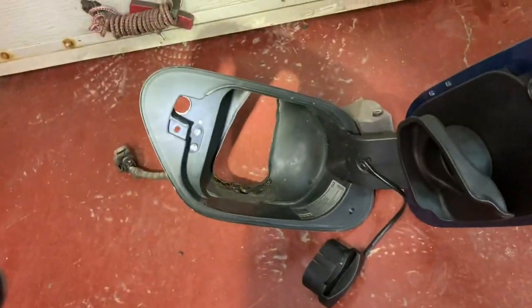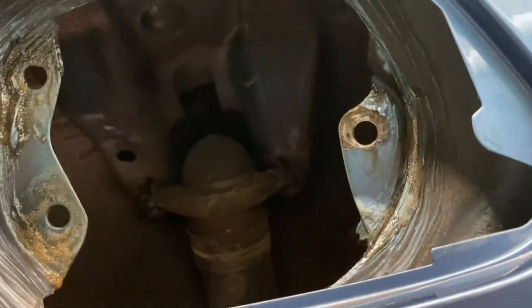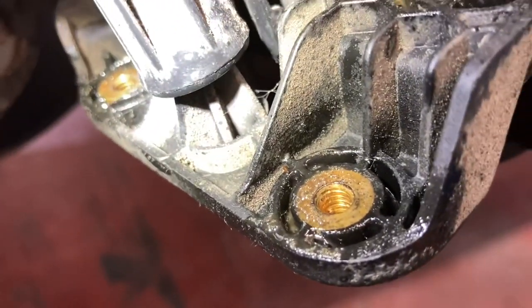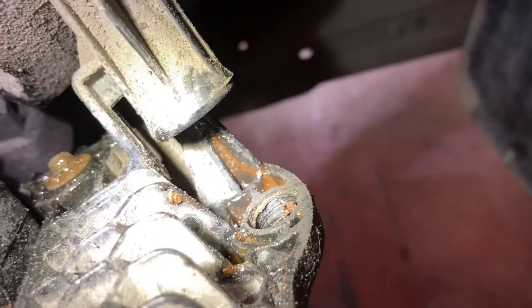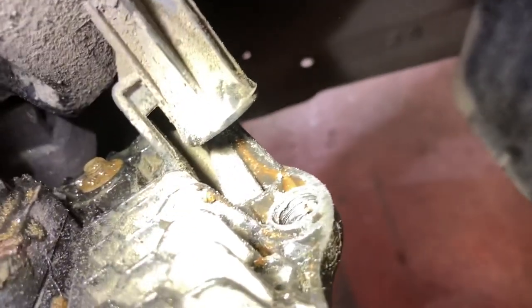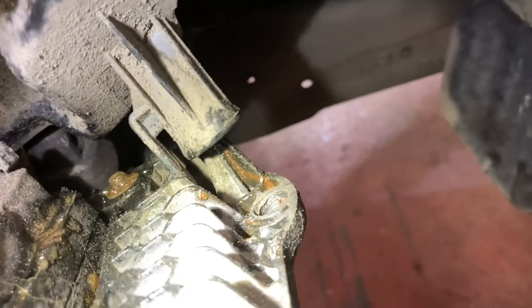The screw is at that location, so you remove the wheel and there are three Torx screws with flat heads - two here and one more there. I had trouble removing one particular screw because this car has been driven in winter. The screws go into a brass piece, but the head was rusty. I was able to remove the easy ones, but the other one - the brass piece spun and I had to go back and forth and spray some penetrant.